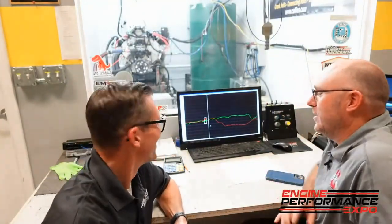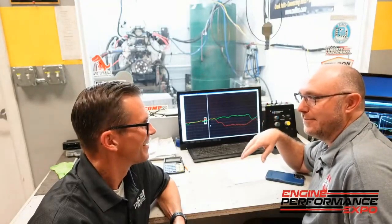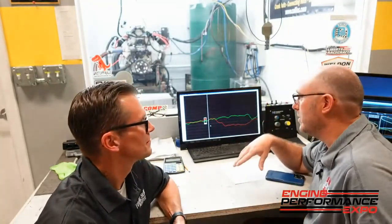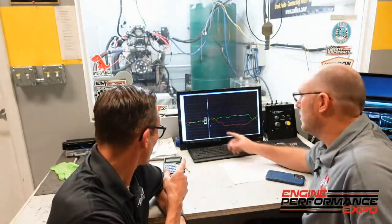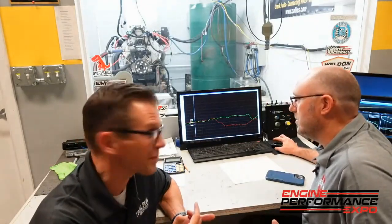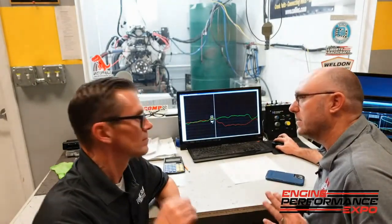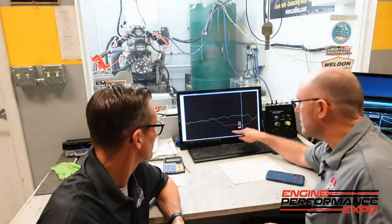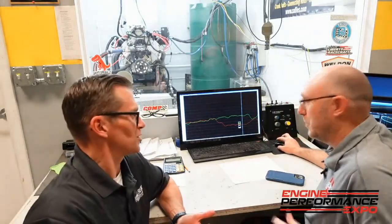What do you think about that one? My heart didn't stop that time. It was pretty obvious what was going on — the oil pressure was rock solid, actually even climbing a little bit. But the whole time I was watching the oil, my other eye was staring at the power going, 'well, that really cost us a bunch.' So we tried to keep the same tune-up and temperatures, but man, there's no way to deny that. You put more oil in it, it's certainly better for the life of the engine. 61 pounds of oil pressure versus almost 40. They both start out right about 60-61 PSI. The old run with only five quarts — at 5,100 RPM they started to deviate, dropping all the way down to 36.5 PSI. By that same RPM, the seven quarts was actually climbing up to 68 PSI — almost double the oil pressure.